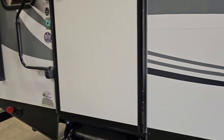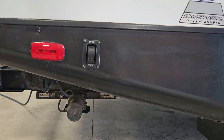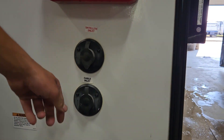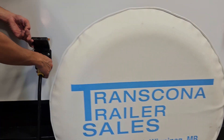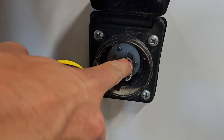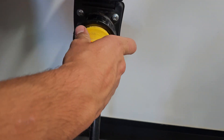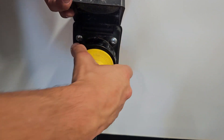The back here is just the rear stabilizer jack. You've got your satellite inlet and your cable inlet. And here you have your 30-amp plug. Just unplug this — you see this little ear here, just line it up with that ear on the bottom, line up those two ears, give it that eighth turn, and you've got a threaded collar to really lock it down.